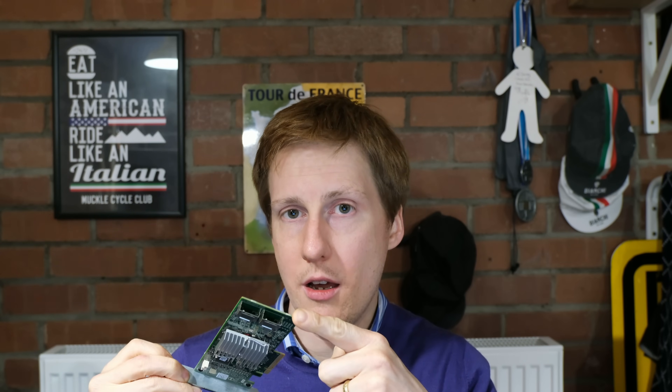The second use case is what I just mentioned. Any drives we attach to this HBA port we can pass this entire card through to the virtual machine, so Proxmox will not have access to those drives. TrueNAS will have access, and thus the requirement for ZFS and full software-based RAID is possible because TrueNAS has direct control of those drives.